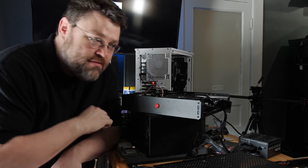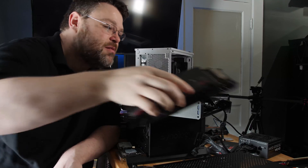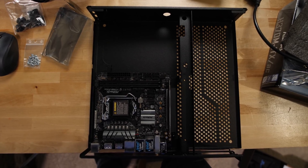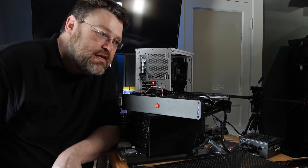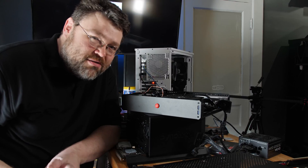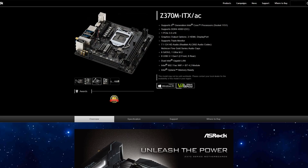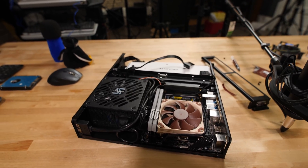Now if you're looking for something not quite 2070-level performance, it's hard to go wrong with the RX 590. This is the Phantom Gaming RX 590. Now, three motherboards tested in this thing. We've got the ASRock H370 — that's an H-series chipset, so no overclocking — but I ran the 8700 non-K and the 8600K. That's technically an overclockable part but you can't really do much except multi-core enhancement. And then also the Z370 with the 6-core. Now the 6-core is about the limit for heat dissipation, and that was one of the reasons I used the Seasonic power supply — to get the 650-watt headroom.